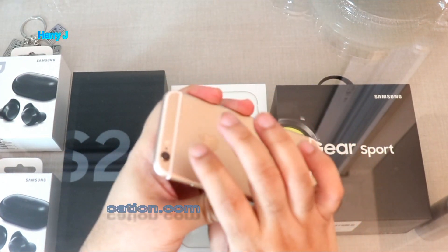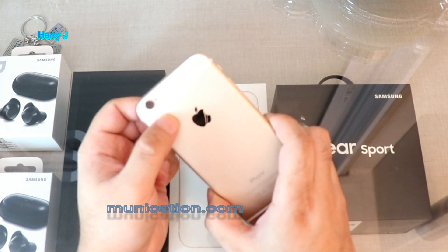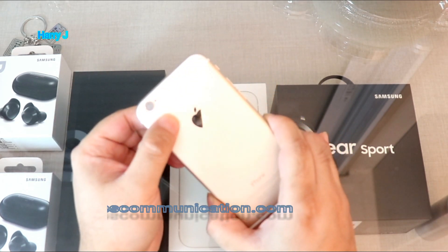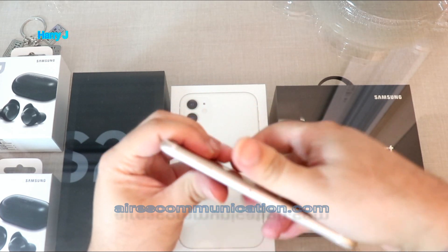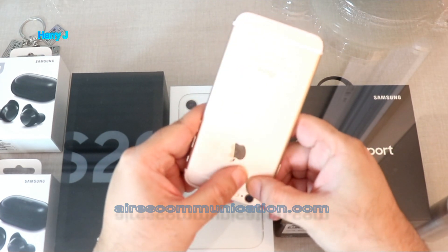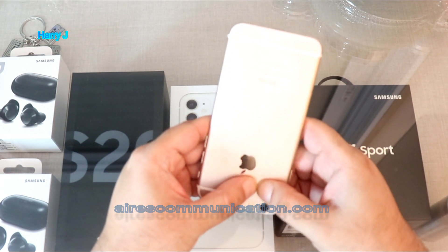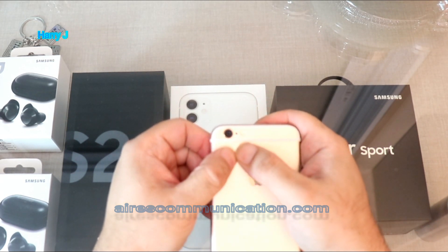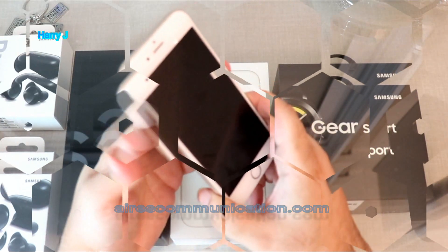The last thing you can do before disassembling the phone: there is a connector that connects to the display, and sometimes when you drop your phone it becomes loose. If you press here with a little gentle or firm pressure, it may reseat the connector. I'm pressing at the bottom near the camera with some pressure to see if the connector fixes itself inside before opening the phone.